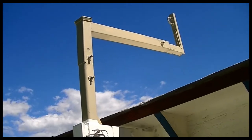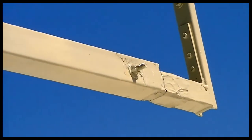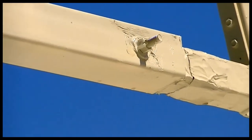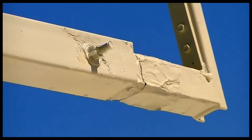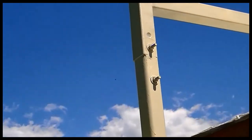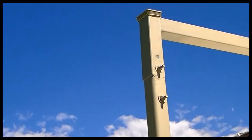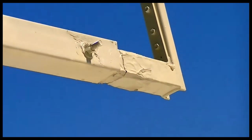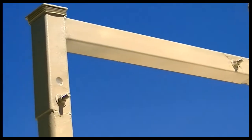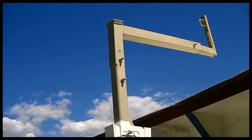This is the completed project. There are two pieces that come in the bed-extender kit. I added this bracket here for stability. One piece had a bunch of holes in it, so I taped them with aluminum foil 100-mph tape to keep water out, and I cut the L-piece right at the joint so I could use it as an insert to join the two pieces together. I also siliconed the joints on the top and sides, and all penetrations, to keep out water and reduce movement a little.